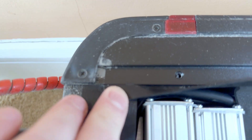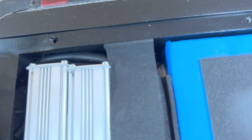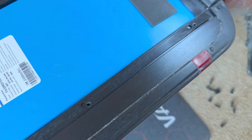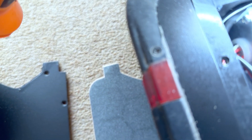It only takes a few minutes to do something like this and I would highly recommend doing it from time to time, because water can seep in basically anywhere if it's not sealed correctly. In this occasion, after closely inspecting even in between the battery compartment, everything seems pretty solid. Sometimes there is a tape that changes to a pinkish color when water gets in on the batteries, but in this case it's not there. It's something to definitely look out for if you have a different electric scooter.